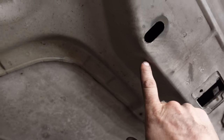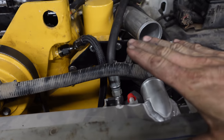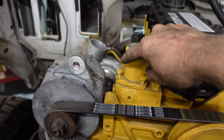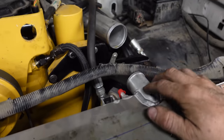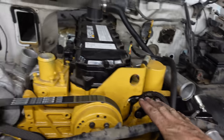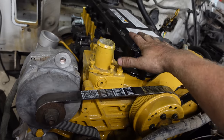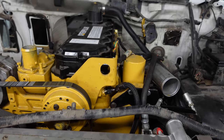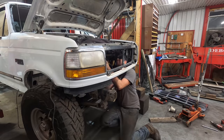I'm going to cut all the way along and stick it up into the hood a little bit — cut right behind the support for the latch, and then rather than go on an angle, make it into a 90 and stick the rad up into here just a bit. That will bring it up nicely parallel, come straight out, then do a nice jog over and in so the coolant pipe is perfect. You want the rad higher than the top of the coolant in the cylinder head, otherwise you risk having air stuck in the cylinder head which leads to hot spots. It'll look a little goofy right now but we'll clean it up and paint it all nice.